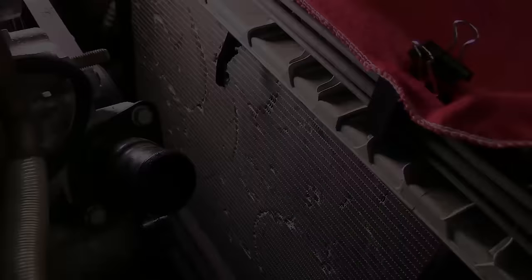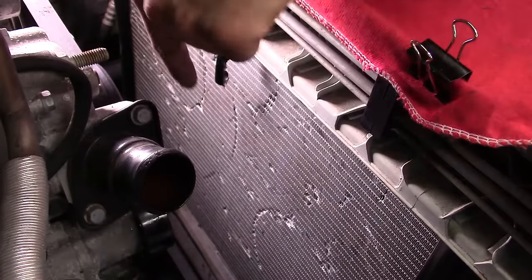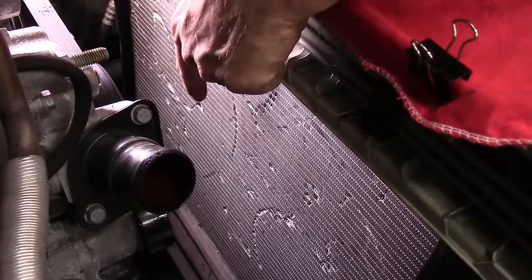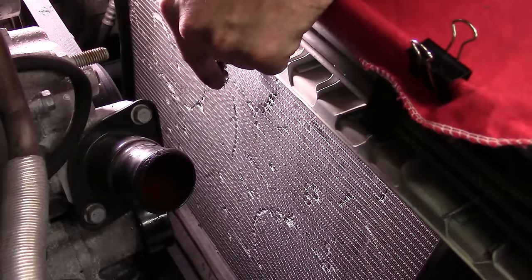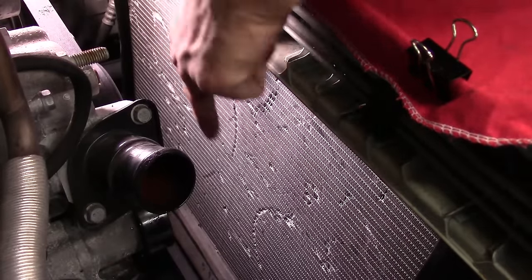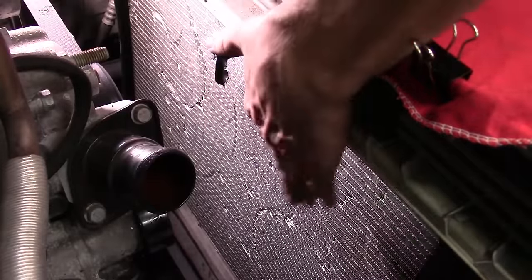As you can see, you can see all the circle patterns and all the damage that occurred when that fan blade started coming apart on both of them. We've got some real deep gouges in different places on the radiator, especially on the driver's side. That's one reason why this is going to get replaced — it's weakened the aluminum fins. Some areas haven't started leaking yet, but there's a very good chance that with enough pressure and heat it will start leaking. Definitely the blades made contact with the radiator, and that's why it's getting replaced.